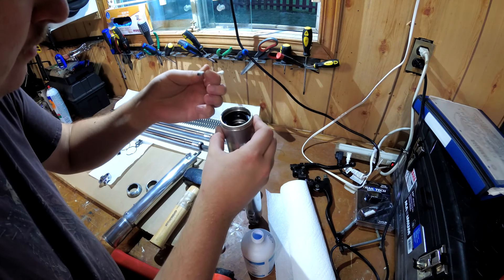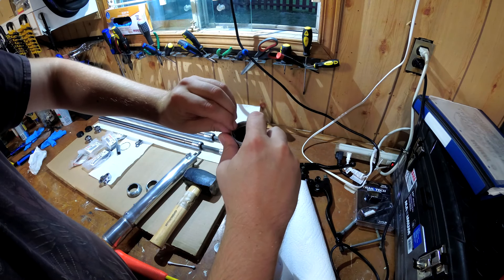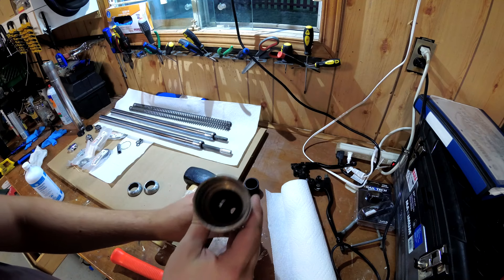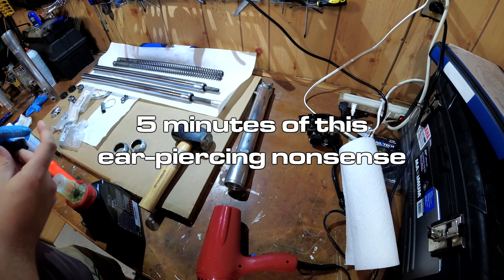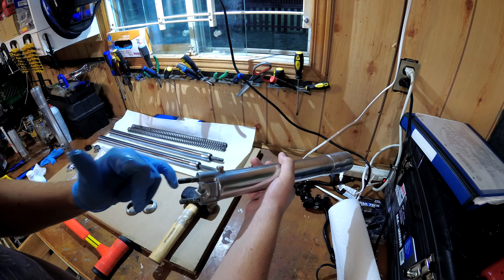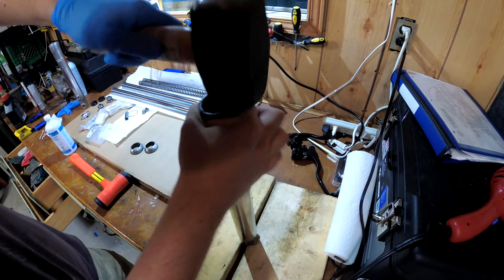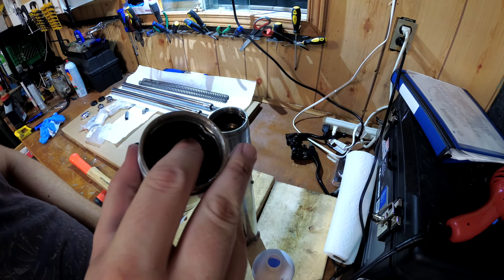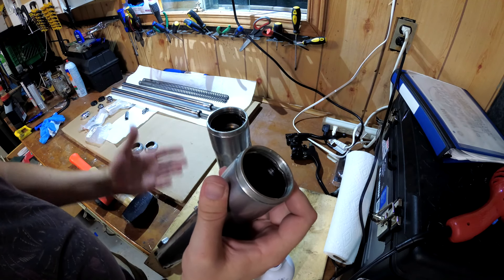You live and you learn, right? Now I want to put the snap ring back in. Let's do the other fork lower. For this fork, I'm going to heat it up first, as I think that did help with getting the other seal in — if I had done it from the beginning it would have gone much smoother. That was going in much smoother. I really hope I didn't mess up this one because I really whacked at it for a while. I don't know if I recessed the seal inside its enclosure too much. But you live and you learn. If I have to rebuild this one, I guess I'll just rebuild it again.